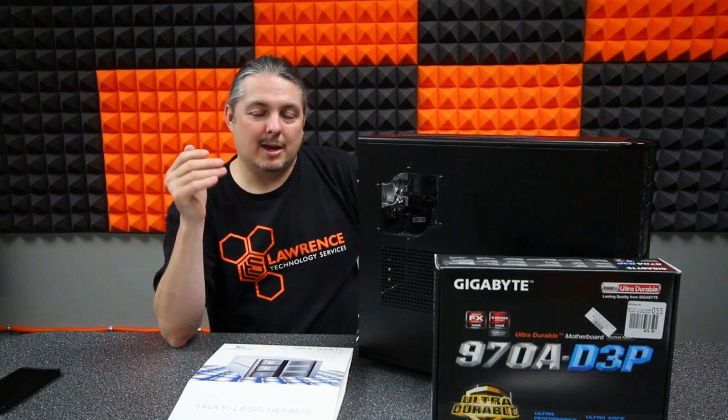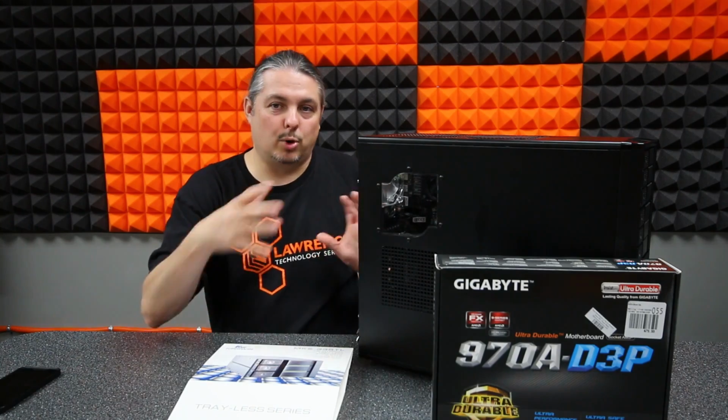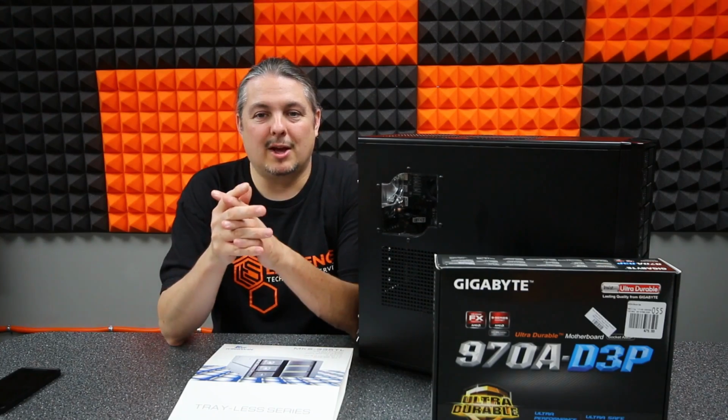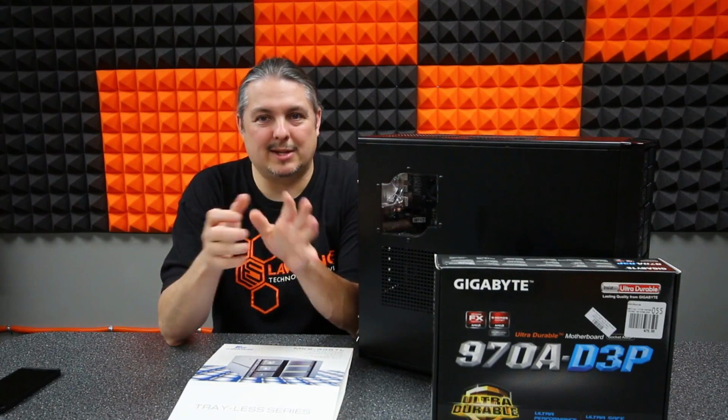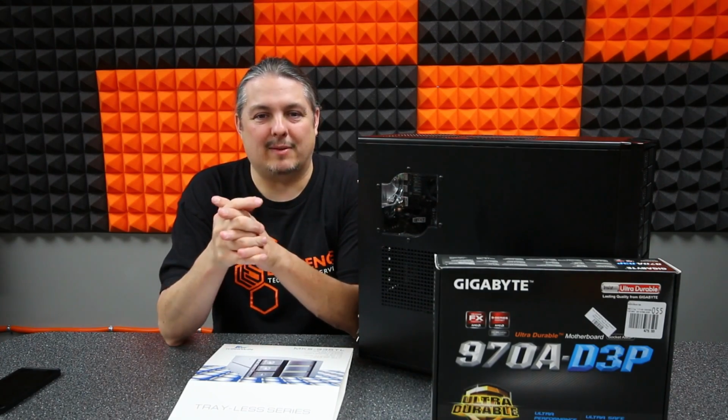So while one's being rebuilt, if another one were to fail, there's enough data there. Now you can go even further with RAID Z3 and it reduces the amount of usable space, but we didn't need to go all the way there. RAID Z2, 2 drive failures, and we're good. We can survive that on here.